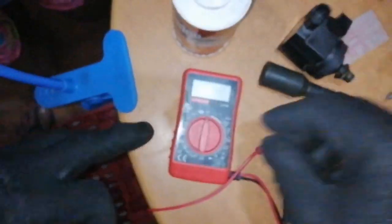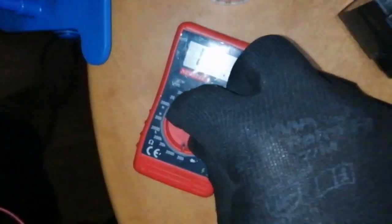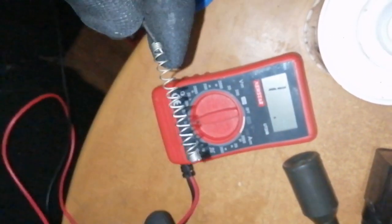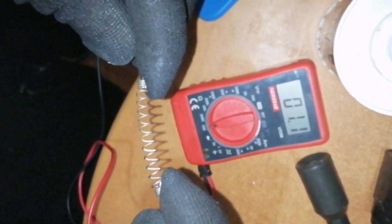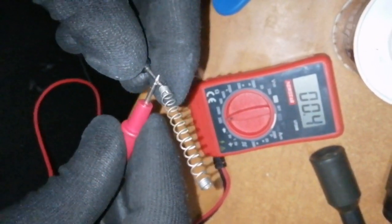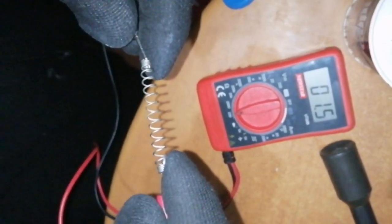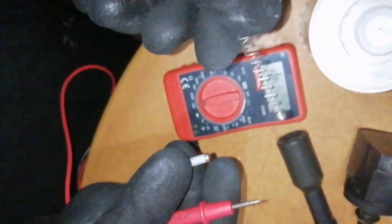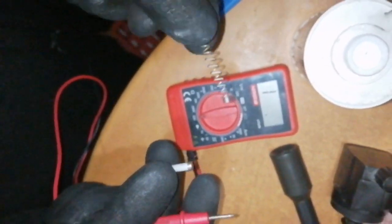Okay, let's measure the resistance again. So it should be close to 0. I set it to 20 kilo ohms, should be setting it to 200 ohms. Okay, should be acceptable then. So the leads are inherently around 500 milliohms. So there's an error of around 600 milliohms. Should be fine, because the resistor is typically around 1.88 kilo ohms. And even if I just have 1 ohm, that is just around 0.1%. So that should be fine.